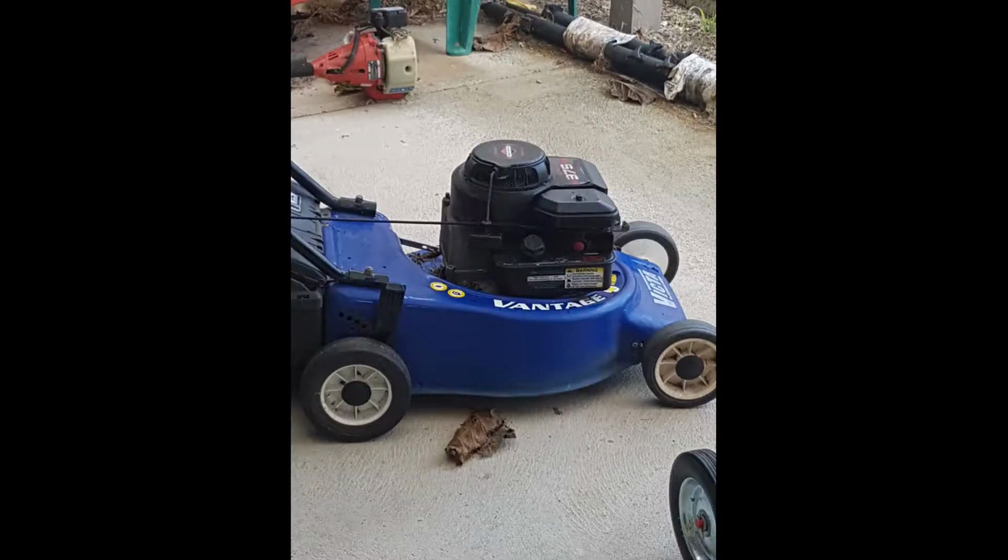The thing is that while you've taken it out and you are cleaning it, you want to make sure that you put the container that is the air filter, or that metal bit with the screw, back onto the lawnmower so that the lawnmower is covered and there's not gunk and dust and stuff getting into where the air filter normally is. So make sure that you do cover the lawnmower, the hole that the air filter leaves, while you're off cleaning the air filter.